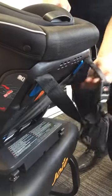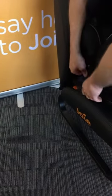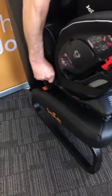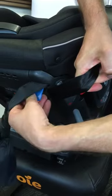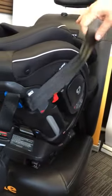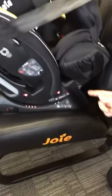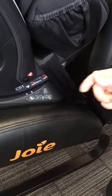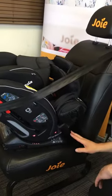This upper guide is also a lock device. Before locking the seatbelt, ensure sufficient tension on the seat — it's best to get a bit of weight onto the seat, leaning on it whilst keeping the base flat. Pull through on the lap belt to get all the slack away from the beginning of the seatbelt, then gradually feed that slack back up through the diagonal seatbelt. As we get that tension up at the top, close the clasp onto the seatbelt to keep all the tension in. A key check at the beginning of the seat: if it's tight enough, you can flick it — if that bit's tight, the rest of the seatbelt around the seat is also perfectly tight. That's a very important check.